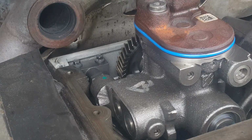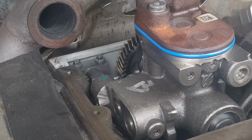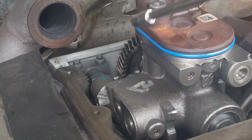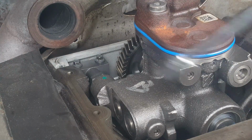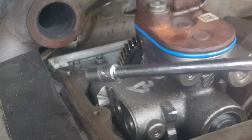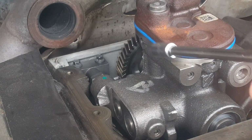Okay, quick rundown of how this high pressure oil pump works, or I think it works. It's getting fed oil, the pump run by the pulley in the back, that gear, which is connected right to the crankshaft itself, I think. It supplies the oil, pressurizes it up to like a couple of thousand PSI in that STC connector, down to the branch tubes, which go to each side, and they're the ones that supply the other faulty part, which is a standpipe rail, which feeds the oil rails up here and the valve heads.